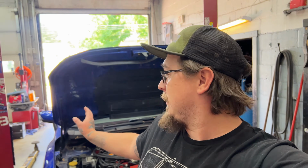So after the tuning issue with the engine, I got approval from the customer to pull this engine out and completely disassemble it so we can see what's going on. My gut is telling me it's probably at least gonna need an oil pump and probably a crank and bearings. I'm hoping the heads are good. I'm hoping the turbo isn't damaged. It's gonna be hard to say for sure until we get in there.